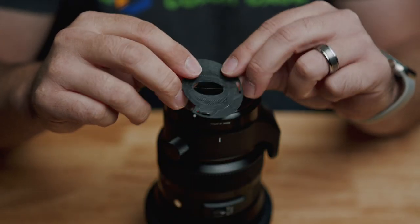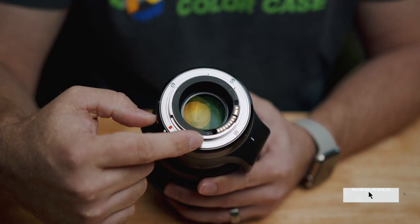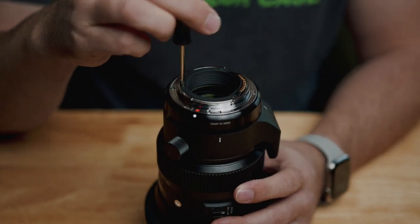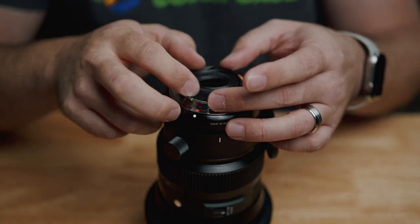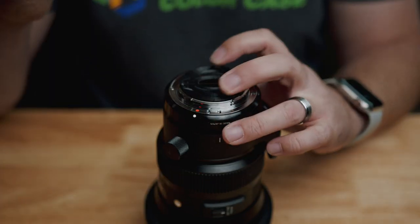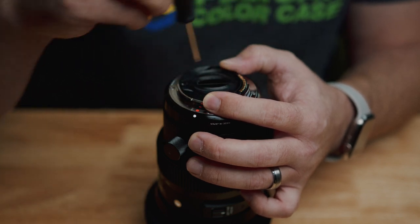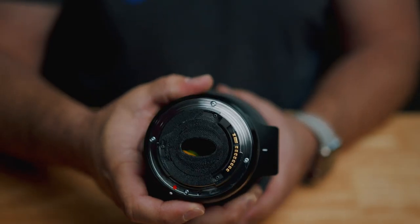This little piece screws onto the back of your Sigma lens. You'll need the smallest Phillips screwdriver you can find, then loosen — don't remove — the three screws on the back of your lens so the adapter can slide right in. With those three screws loosened, slide the adapter on with the rough side facing down and the smooth side with the 3D print design facing up. Rotate it so the screws fit into their tight slots, then tighten it up.